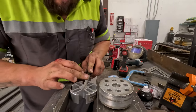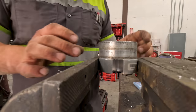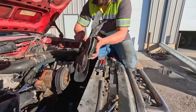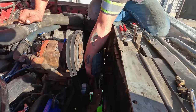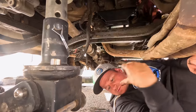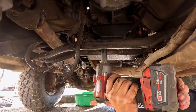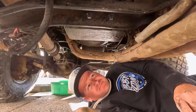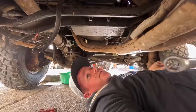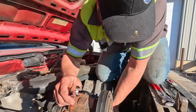Filing away the burr so I know it sits flat. It sits flat and flush, it's centered, so we're good to go. Put it on - boom, just like that. Fan on - I'll hurry and get these tightened down. I've got the two upper bolts tight. We're gonna let this jack down, let the transmission come down, then put the nuts on and tighten that down. They had one radiator for this vehicle in stock, so I took it because we needed it.